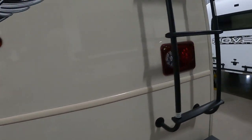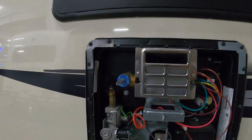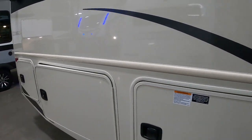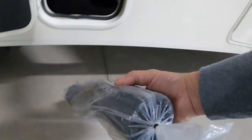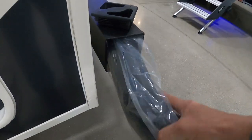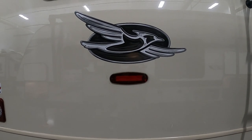Before putting everything away, if you're done camping for the year and don't want to leave hot water in your hot water heater, open it up, lift up on the pressure release valve — be careful, some hot water is going to come out. When that's done, push that down — otherwise your door won't close — and then pull that drain plug. When the gray is fully drained, take your sewage tank hose and conveniently and sanitarily store it right in your bumper, and head on home. We thank you so much for your purchase — hope you enjoy this rig for many years to come. Happy camping!